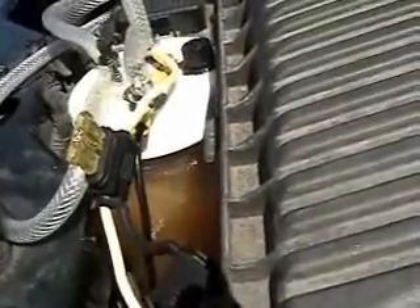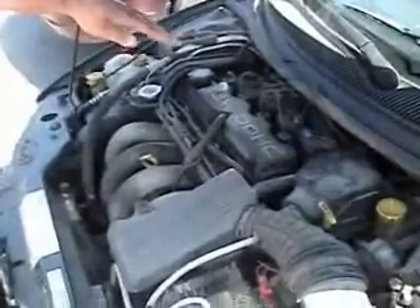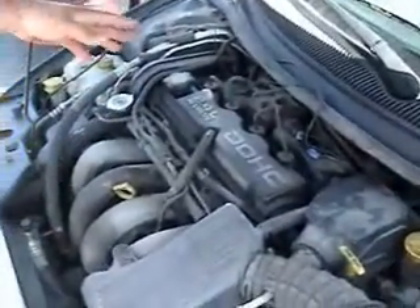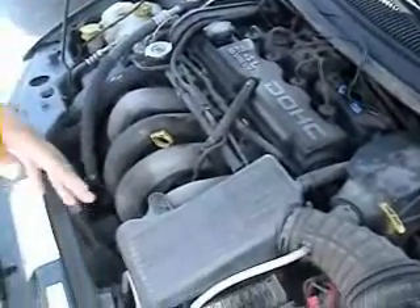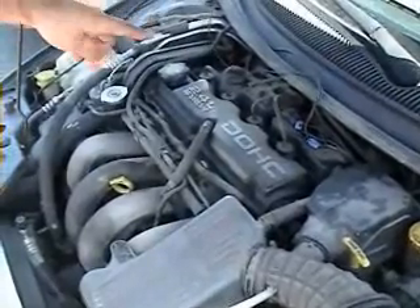Hopefully you can see it — a whitish-colored gas. I just came to a realization: I may switch from using a MAP sensor enhancer to an EFIE — an electronic fuel injection enhancer — because basically this controls manifold air pressure. With the increase of hydrogen and oxygen passing through the air manifold, I'm trying to control the amount of fuel injection being sent to the injectors via the manifold air pressure sensor.